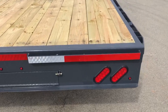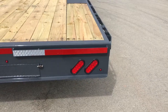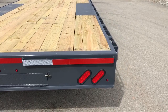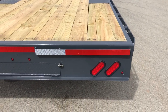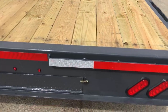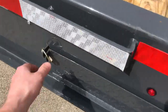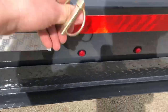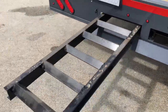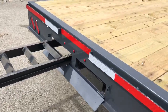Ramps on these are rear pullout. They do put a few extra lights on these — you're only required to have one stop/turn/tail and three markers, but they put an extra marker and an extra stop/turn/tail on the trailer. Ramps are hook style, hooking onto the bar. They've got a container at the back. The ramps are a channel style ramp with your angle iron runners, and they are an 8 foot ramp, so they give you plenty of length.